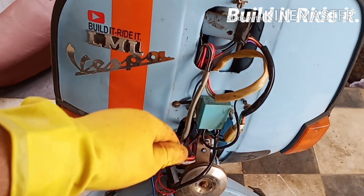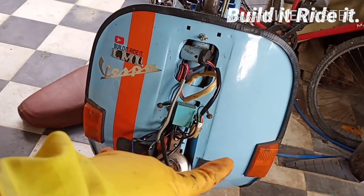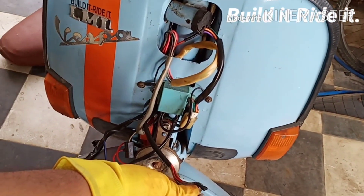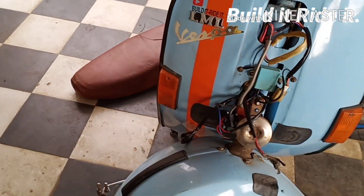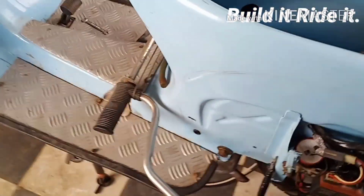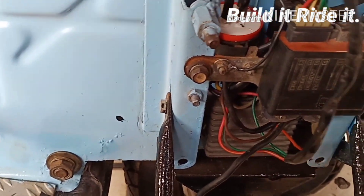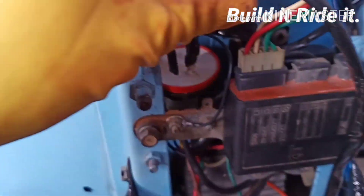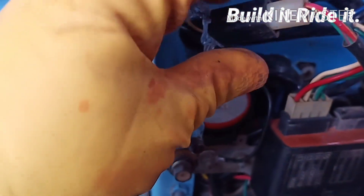This one goes to the buzzer — it's in parallel with the entire trafficator circuitry, so if you're not connecting it, it won't cause much difficulty. But if you decide not to connect it, make sure to tape or insulate those wires well to avoid any short circuit. At the rear, I've done a small modification: this is an aftermarket flasher unit. It has an earth connection, and like the factory LML unit, two points are connected. However, the connecting points on the aftermarket unit are flat-pin type, whereas the LML unit uses socket-type connectors. So I took a socket from the old wiring and made the connection with two connectors — now it's compatible.